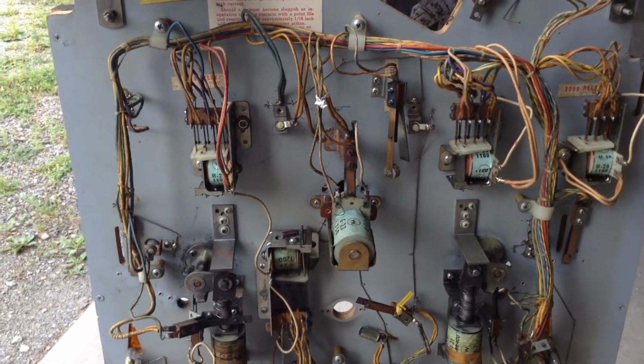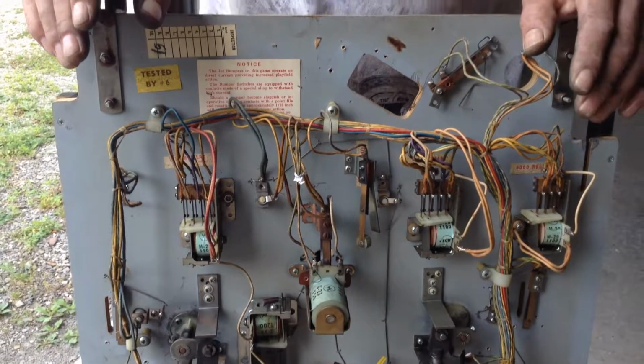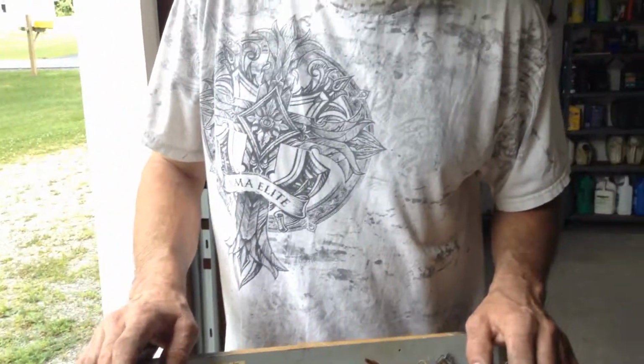So don't get too overexcited and just tear everything apart and throw it in the pile, because you'll get disappointed, aggravated, and that's probably where it'll sit for years and years. If you take your time, I'm approximately 2 hours taking my time, loosen apart, pin everything up, put the pieces over on the table that I'm going to clean. Take some pictures of this stuff, front and back. That way you have documentation of how you put this thing together once you have it all ripped apart.